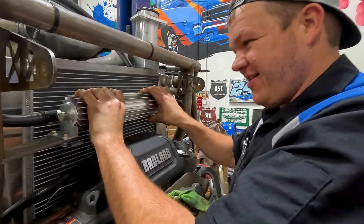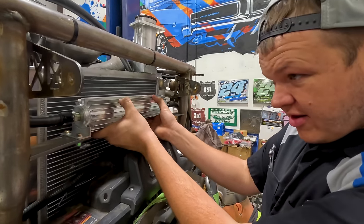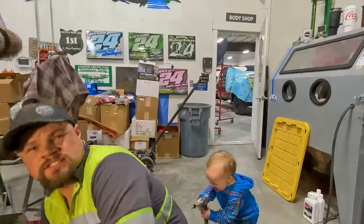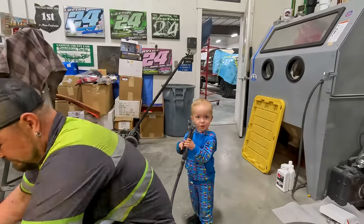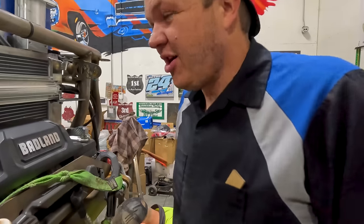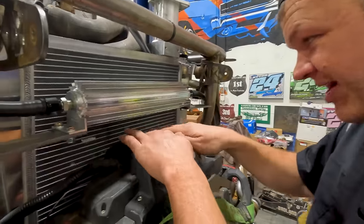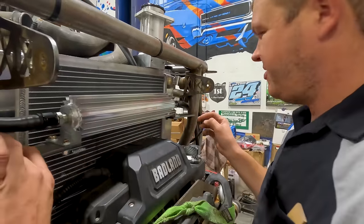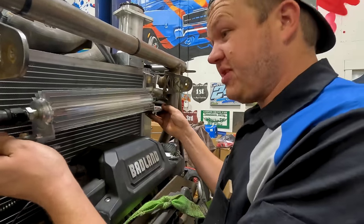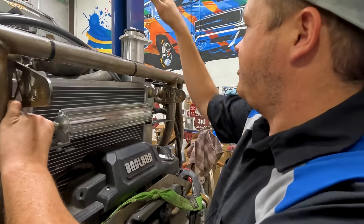All right, so check this out. Hey, it's super tight. So this fits really good here, but I want to bring it down. Lincoln's going crazy on Hillbilly's air blower. Hey! So don't mind the air blower. Lincoln's a trained professional. Everything's fine. So I want to get this down to about an inch above the winch. In order to do that, I'm probably going to have to grind out just a little bit. This fits really well. So I'm just going to take the grinder and get that down, get that welded in, and then we'll move on to mounting this.